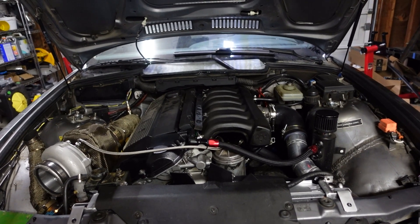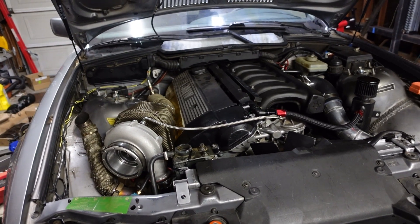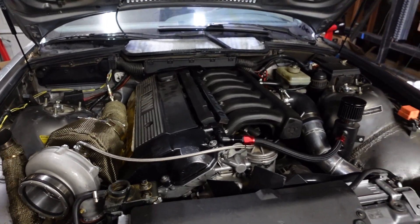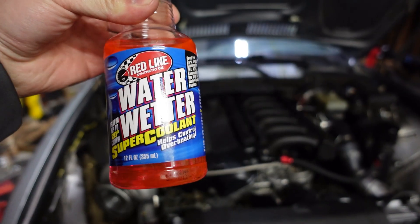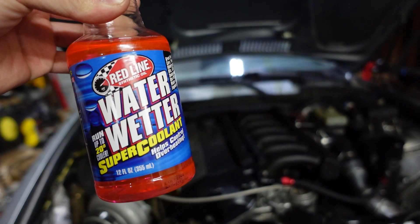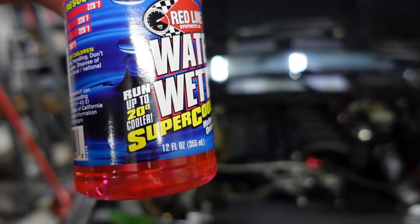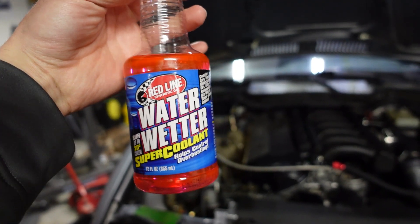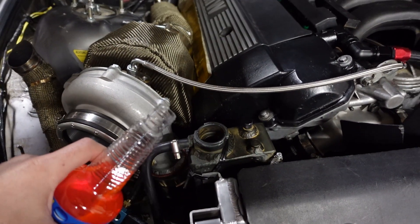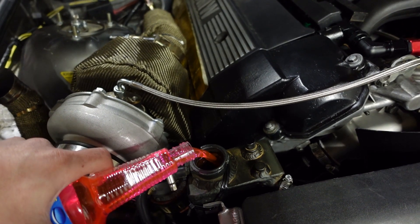The cooling system bleeding was successful — everything went really well. We got everything bled properly and temperatures seemed to be sticking around 180 degrees Fahrenheit, which is fine for what we're doing. The next thing, as kind of the final touch, is to introduce some Water Wetter to the system. It's made by Redline — we have a couple of Redline products already, hashtag not sponsored. Essentially it's supposed to help cool the cooling system, supposedly running up to 20 degrees cooler once introduced. I don't know if this will work too well, this is kind of me just experimenting with it. We'll see once we take it to the track. But now that we don't have any coolant leaks, this should help a lot and the whole system should work much better.